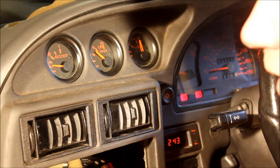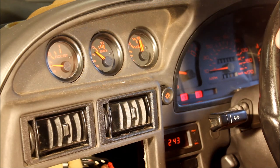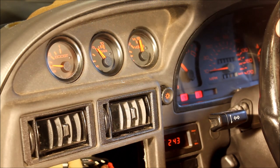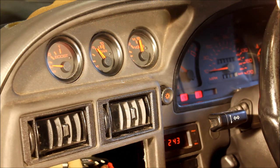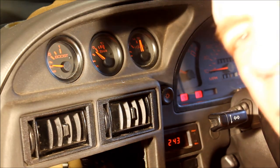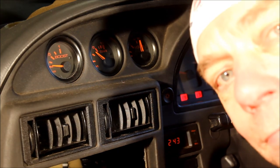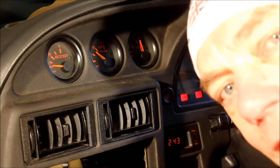There we are — ticking over at 950 rpm reading about three bar. As I increase the engine speed up to 3000 rpm, you can see it goes up to five bar but doesn't go any higher, because by the time you reach five bar the pressure relief valve cuts in to limit maximum oil pressure. Another mystery solved — see you next time.